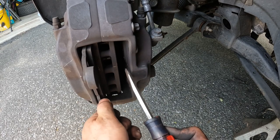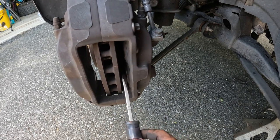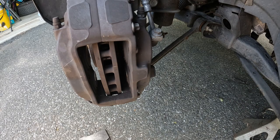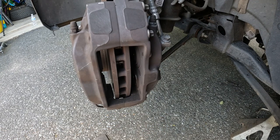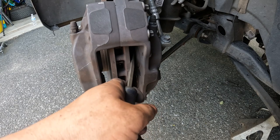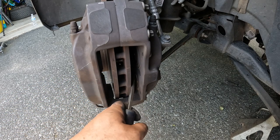There we go — all you need is just enough movement to get your pad out. Then later you'll be retracting the actual pistons, but before that I'm going to open the reservoir and see if it's super full or already overflowing. Now that we've got those pads out, we're going to depress the pistons. I already checked the reservoir — there's plenty of room — so we're just going to push them down and push that fluid all the way back up through the system.